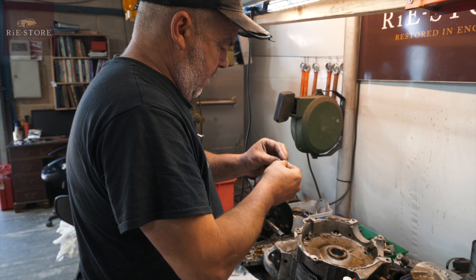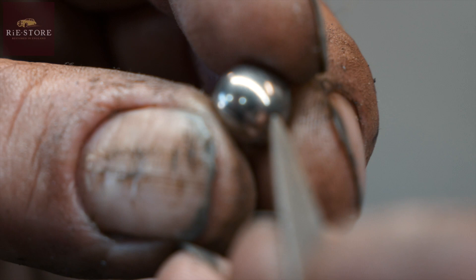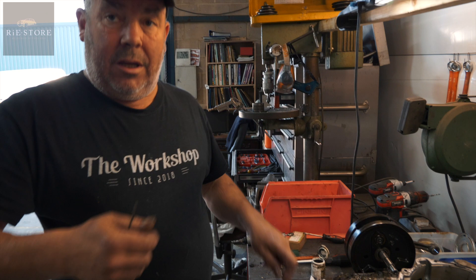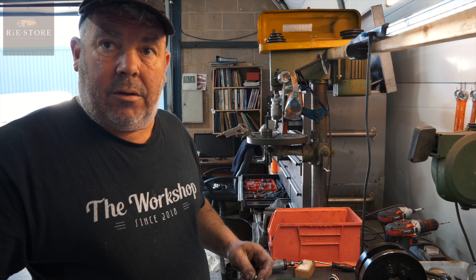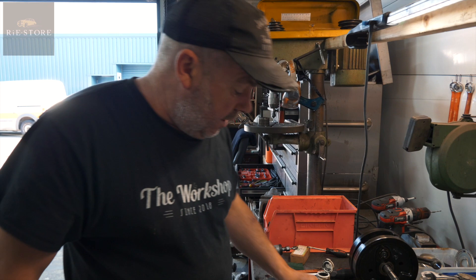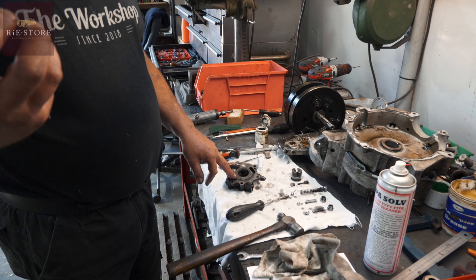That one's marked a bit as well — you can just see a line there, hard to see in the light. So they have been just picking up somewhere, which is why you rub your ledge out. Because these casings are so soft, it will just dig itself in and form a ridge around the top. Five or six rotations — it's as soft as cheese. Just take that lip off, put new ball bearings in. Nine times out of ten that's all you need, unless it's rotted out with water and got holes in it, which you can see if you look carefully.